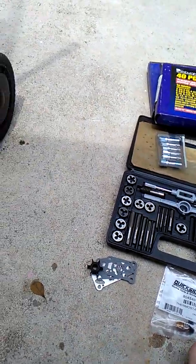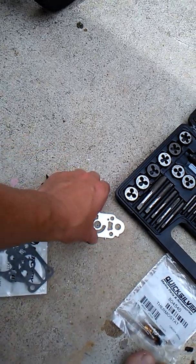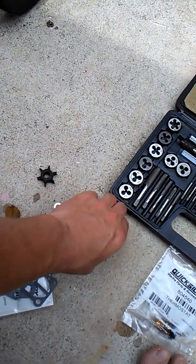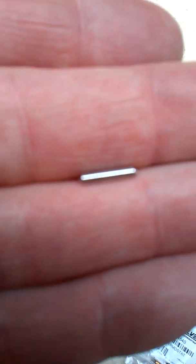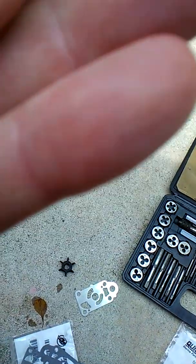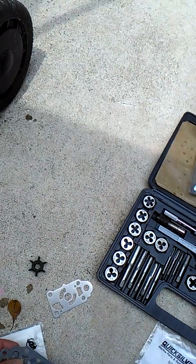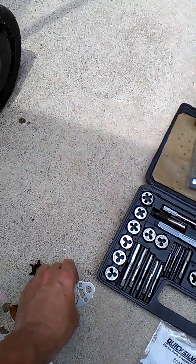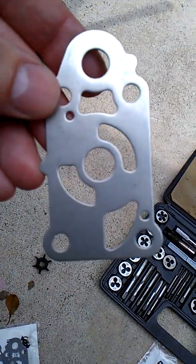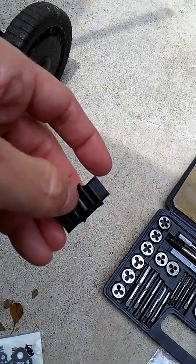I will say to be careful because that little pin falls out — it is very small. As I think it did fall. Yep, there it is — the little pin here. This is what keeps the impeller wheel intact with the drive shaft. I'll show you that in a minute or so. But when you order the kit it comes with both gaskets, plus the metal plate, and those gaskets are going to sandwich that metal plate plus the impeller wheel.